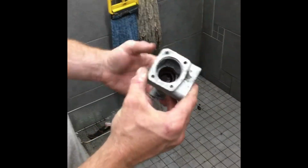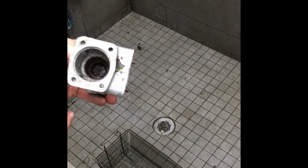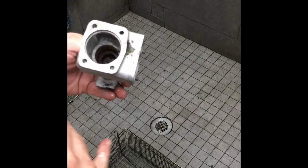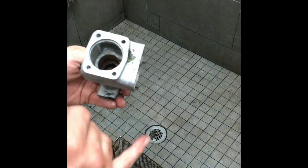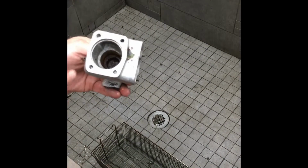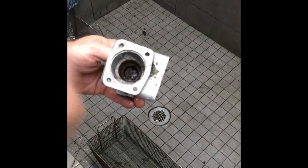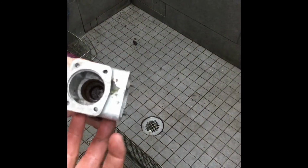Okay, so now this is another wheel cylinder. This one is in very poor condition. There was no fluid going to this wheel cylinder at all. The brake hose was dry. Therefore, everything in here has got a lot of water. It's been sucked up into it, and it's rusted everything. So the cylinder sleeve, if you will, is steel, and the housing of the wheel cylinder is aluminum.